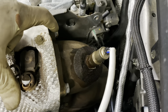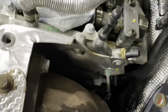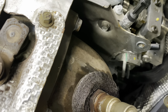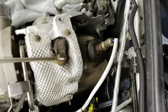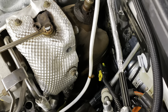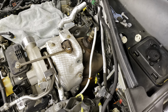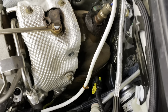There are two 13 millimeter bolts and two 13 millimeter nuts — one here and one buried underneath. With an extension, some creative thinking, and a 13 millimeter socket, you should be able to get it out. We also have to disconnect it from underneath where it connects to the exhaust pipe — that's going to be another two 13 millimeter nuts. There's also a nice little roadblock you might come into getting this thing out.